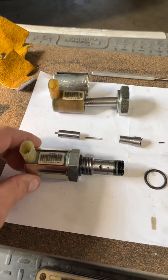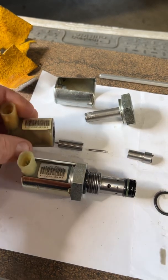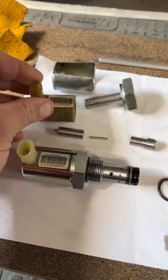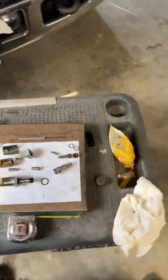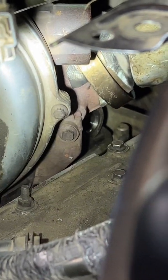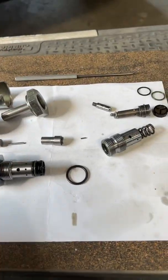The aftermarket ones aren't going to last. The main failure in these is the magnet — you can see from the discoloration they just get hot. It's a bad spot for it to be. It mounts right on the turbo, right behind the hot side on the high pressure oil pump. That's your Y-pipe coming in, so it's just a bad spot. I wanted to do a video on this because I haven't found any videos showing this thing broken down and how it works.